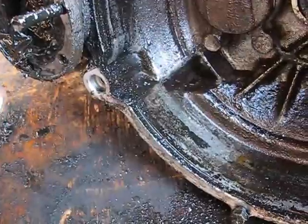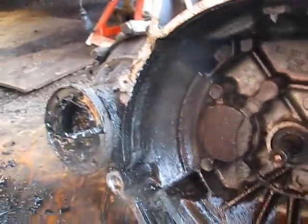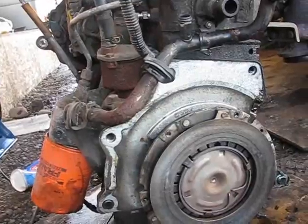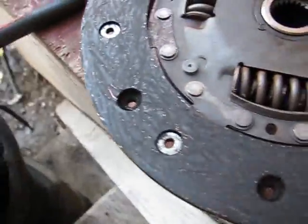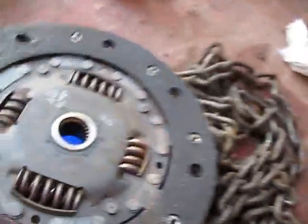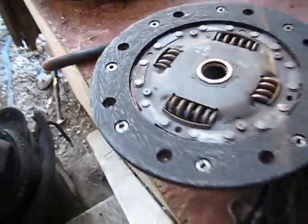All right, it's good to go — just little bits of crap in there. I got it fixed up and slapped back together. I personally think this clutch is good. I brake-cleaned the frig out of it, used a pick and got rid of all the gunk in all the holes and around the edges. Then I took some 400-grit sandpaper and lightly scuffed up all around it — took the shine off. It's pretty matte now, no real shiny spots on it anymore.